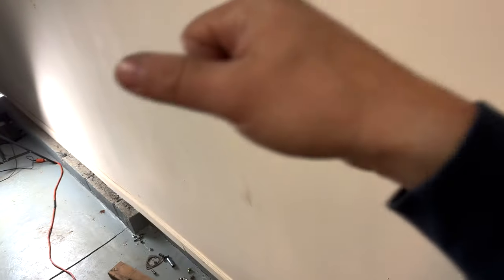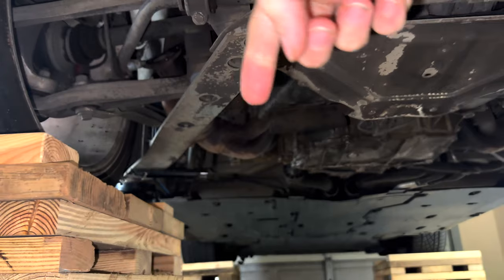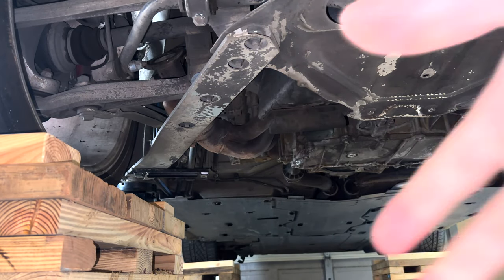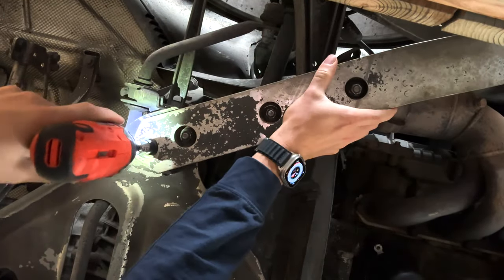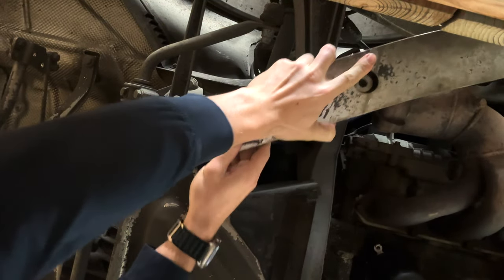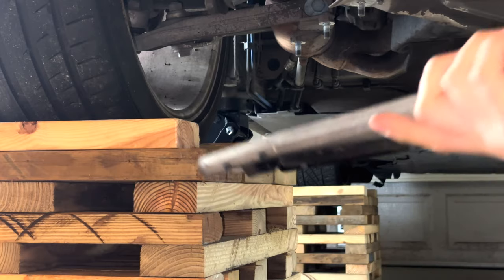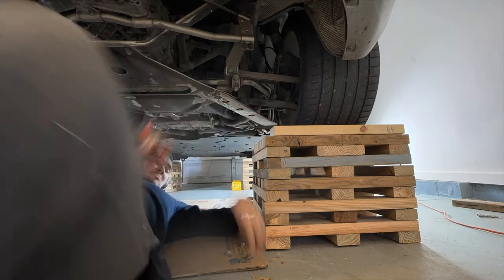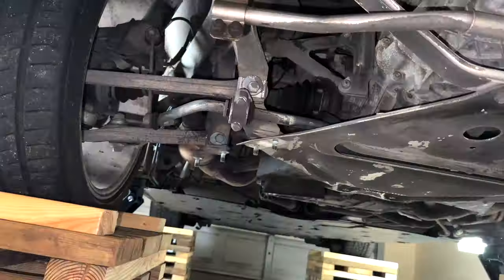Use cardboard to label everything and plug the screws and bolts into the cardboard. Chapter 6: Removing the aluminum braces. Brace bolts at the end should have already been removed. With the farthest bolt removed, let's go ahead and finish removing the driver's side and the passenger's side metal support bars. Here's what the vehicle looks like underneath without the metal support.